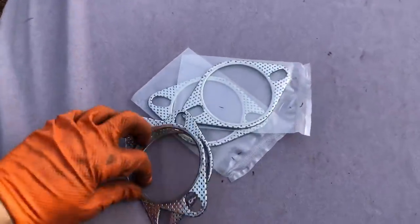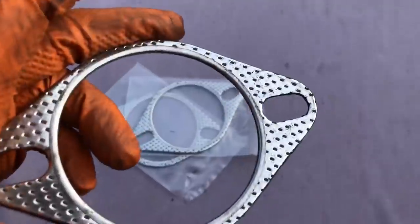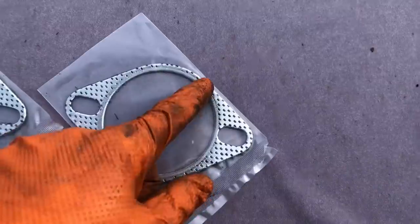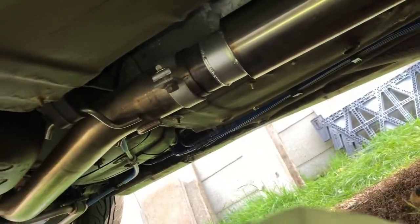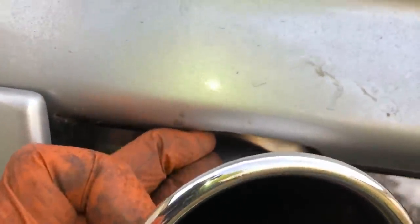I've just got some extra gaskets to sandwich together. The issue with cheap gaskets from China is they don't have a firing ring on them — the only way to get them to seal is the ones with the firing ring, like the old CVH engines. Here's a better daytime view of the exhaust system — you can see much more clearly than at night. I've had to do a slight modification and twist the exhaust because it was rubbing on the rear bumper. The tip was sitting on the rear bumper and just melted it a little bit.